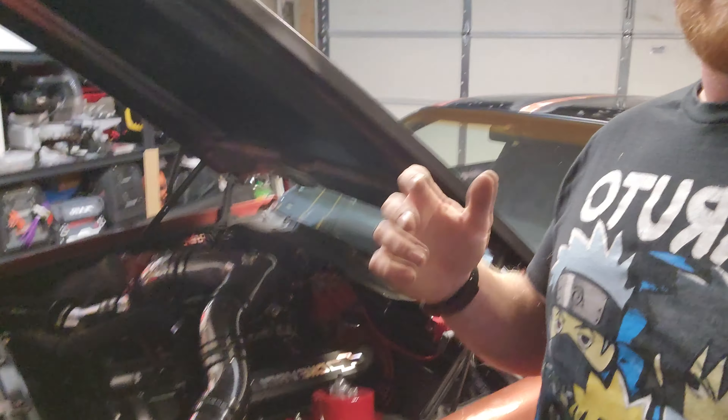There are lots of little maintenance things here and there. I'm going through and cleaning up underneath the car because — I think it's my exhaust — but this car gets absolutely filthy, not even driving on country roads. Just the amount of dirt that the exhaust blows around makes it filthy under the car. So every few drives I wipe down the underside. I'm also going through and cleaning up the engine bay. I also found some loose bolts on the pulley setup over by the power steering pump — one was completely backed out and just sitting on top of the pulley, so I put some Loctite on those. Two others were loose, one completely out. So I'm going through everything now: checking hoses, wires, nuts, bolts. We already did an oil change which looked pretty decent — a little bit of metal material in there, but that's expected with a new engine.